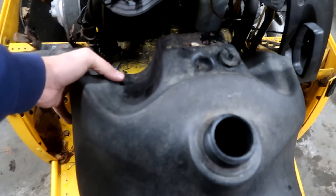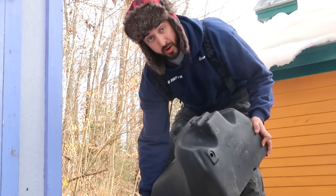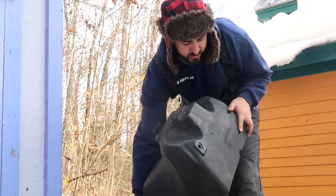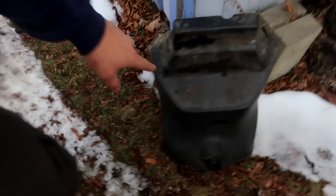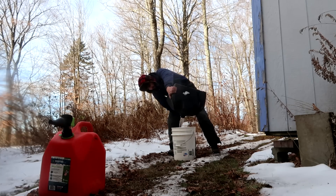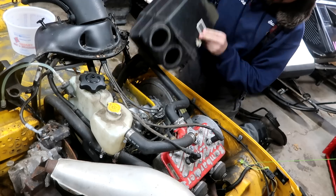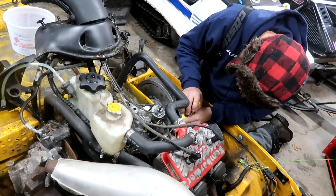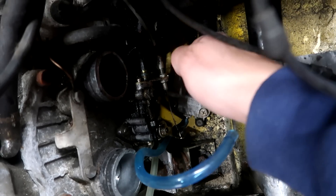Shot off like a rocket — so easy. I don't have a proper gas tank to dispose of this, so I'm gonna put it in a bucket for now. I'll throw some fresh gas in, swish that around, try to get more out of it. I'm gonna speed through this because you saw it in the last video — first we get the airbox off, then we take the carbs off. One thing I love about these old sleds is they're so easy to tear apart. There's the fuel pump — let's rip this thing out.